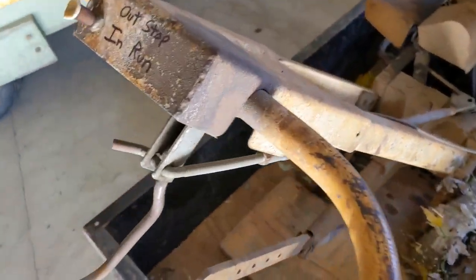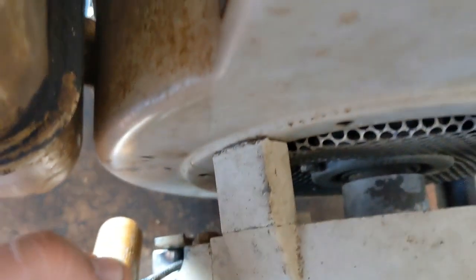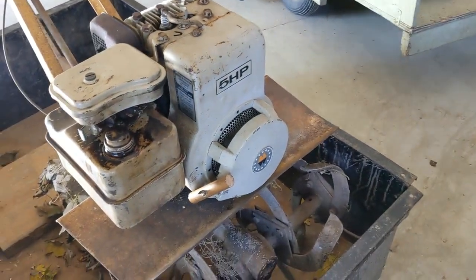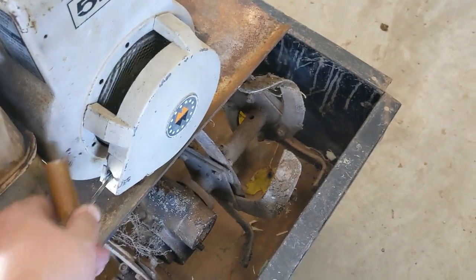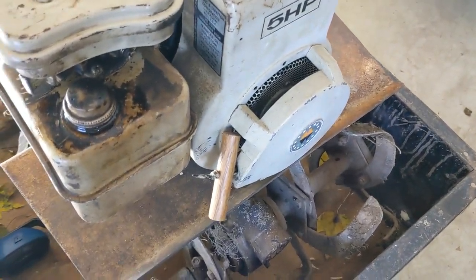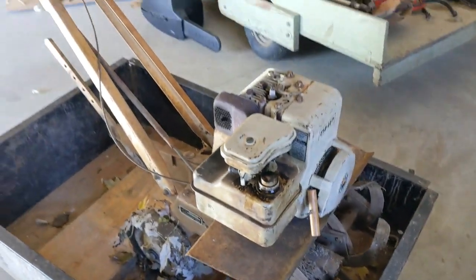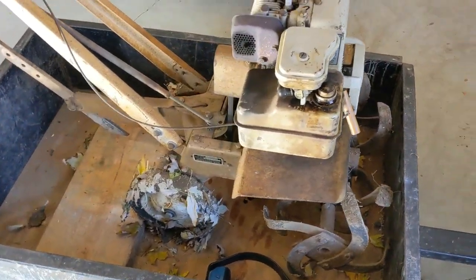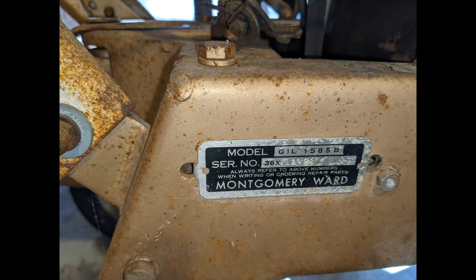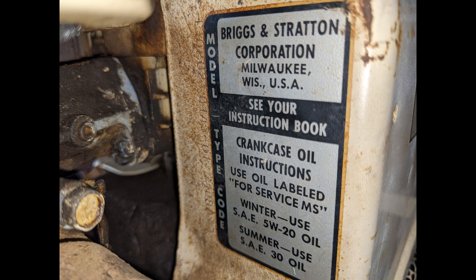We did redo the rope on this, but I noticed this is hanging out a little bit and I can't see the knot at the end of the recoil starter. Super easy - I'm going to take that right back off and put a new rope on it again. The spring's not the problem, the knot just pulled out. We knew that was too small of a cord when we put it in there, but now that we know everything else works - that's it. Thanks for watching. Cousin, if you're watching, this is going to be on the way to your house before spring.